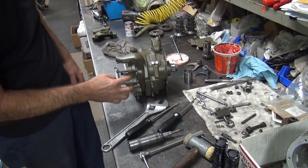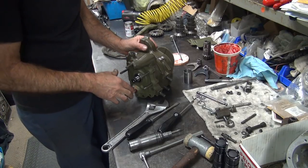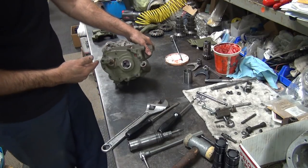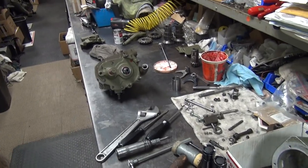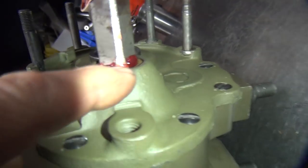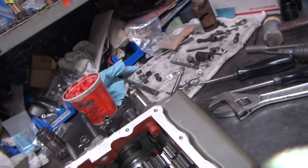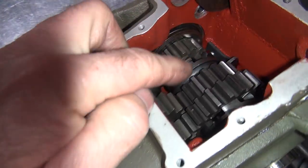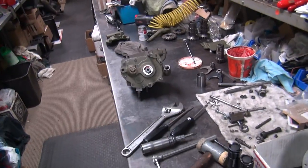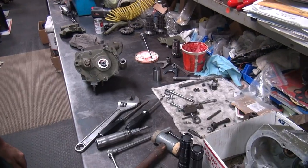Okay, so now these are very tight against the shoulder right here, so that keeps it getting snug. Okay, this is relatively loose here because I don't have it pulled down yet. You want to make sure the kicker works. Now there's no rubber pulled up off of the kicker in here. If you saw a bunch of rubber pieces in here where it's torn, then that means the rubber that I put up inside of there is now not working. So having it like that means it's in there correctly. I got to put the bearings in here before I can make sure all this stuff in here is correct. A whole bunch of little pieces have to go together and everything has to work correctly or you got issues.